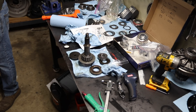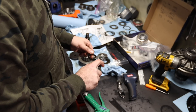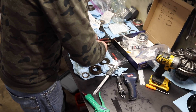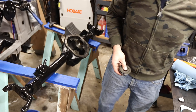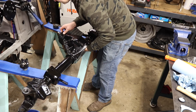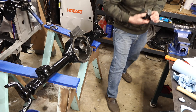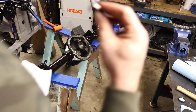I've got my setup bearing for the outside. I need to find my yoke - I'm not yolking, I found my yoke. Don't want your pinion to drop out so put pressure on. Let's put some oil on the yoke. Now I've got the Raytech part for measuring pinion depth. This goes on the head of the pinion and the pinion marking is 900.